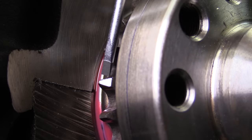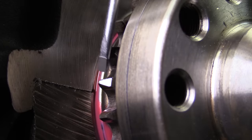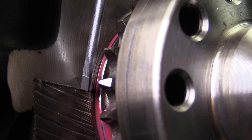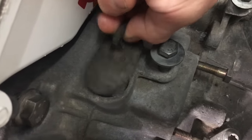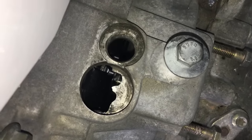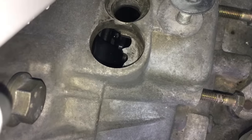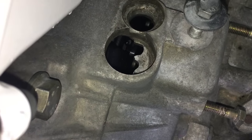On the back side of the engine, there's a half ground-down notch on the crankshaft gear, and that ground-down notch will line up with the split of the main bearing. There's also a mark on the flywheel itself that we can use, but the corresponding mark is on the transmission, so you would really need to have the transmission installed. Also, aftermarket flywheels might not have that marking.